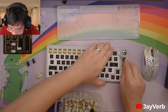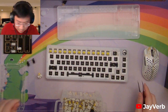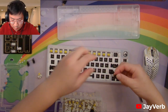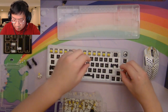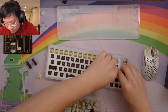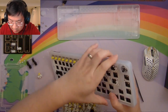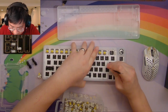I don't think this rattles at all. As long as it doesn't bind, it'll be good. Alright. Get rid of these. These are just cherry stabs with the bottoms trimmed. Nothing special. Put 205 grade 0 on the housings and XHT BDZ on the wires because I am very formulaic like that. I just do the same things over and over again in my life. If they work. If they don't work, I mean, who knows what I do then.